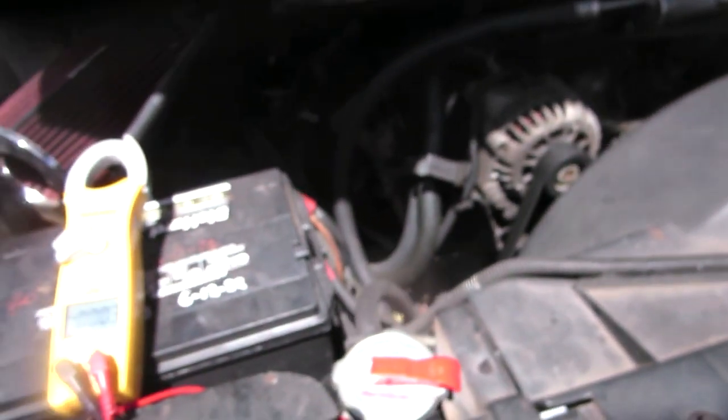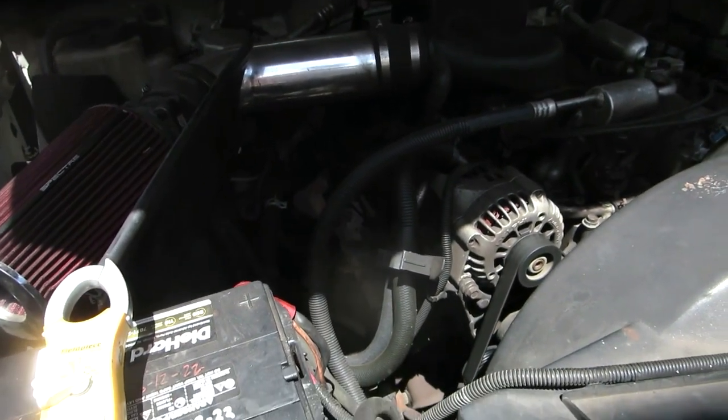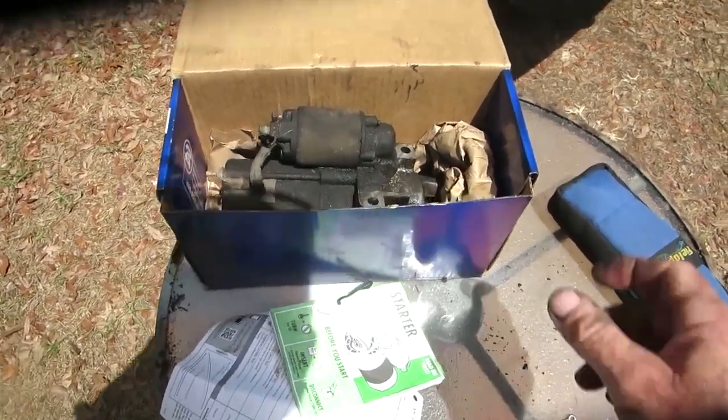14.43. So, 14.5 volts. It's charging. Alternator's working good. Starting good. I'd say we're good. See you next time. Always forget something. Last thing, don't forget.